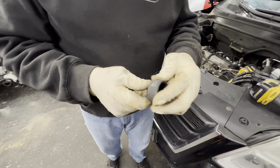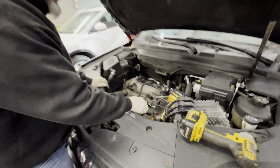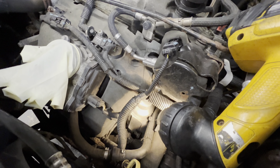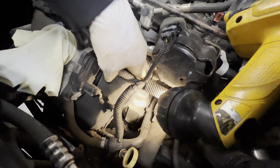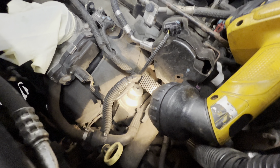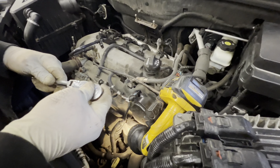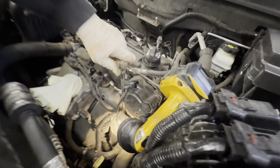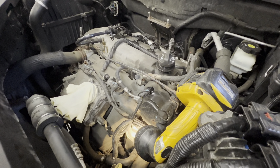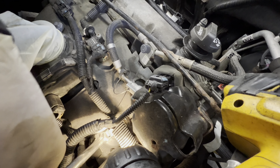We have a 32-millimeter socket that fits on top of the oil cap right down here. I can do this before I drain the oil — I'm choosing to do it now because I'm already on top. We're going to get a ratchet in here. We could probably get a wobbly extension in here, or just try the straight ratchet. I'm going to see if I can get in with the wobbly extension — yeah, it's really not fitting too good. So I'm going to use just the straight-up ratchet here and get it down on there.